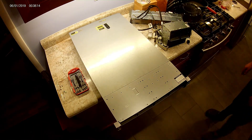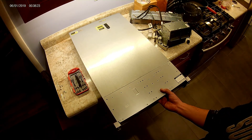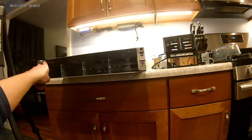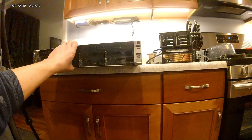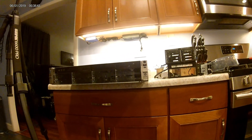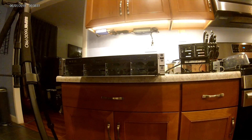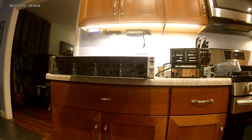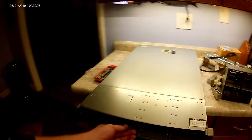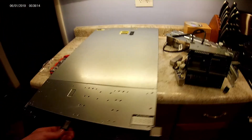You can route this however you like; I really don't think it matters. If you're a purist you might worry about blocking airflow, but it works. Throw the cover back on and now we have an eight-drive LFF server with a DVD drive up front. There was another configuration of these with another row of LFF drives and no DVD drive — that would be a 12 LFF server. I'm not sure if it can be done with this motherboard; it might need a third SAS port, and from what I was looking at on eBay the 12-drive backplane appeared to have three SAS ports and I only have two.